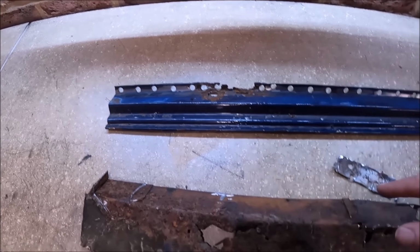Let's just check the jacking point fits, which it does. So that's good, no problems there. Right, now I just need to get this all spotted in. So some people did ask, these are the long tongs I've got for the spot welder. So obviously this is the bottom of the spot welder. This goes underneath the car outside, and this is long enough to go inside the car so you can spot weld the inside. Those are the original short prongs.